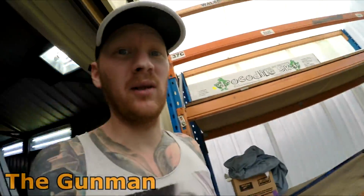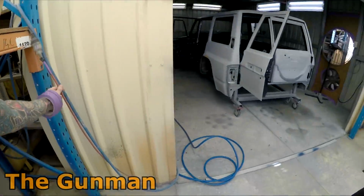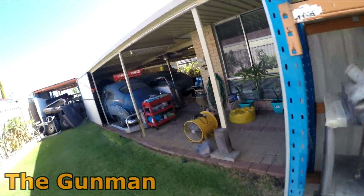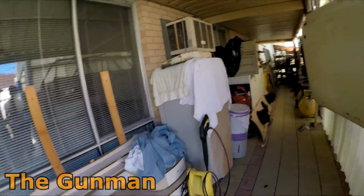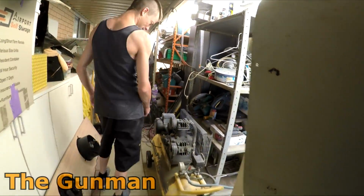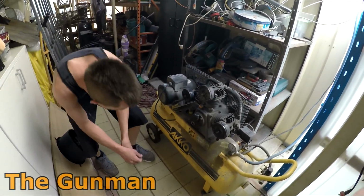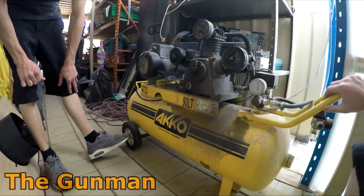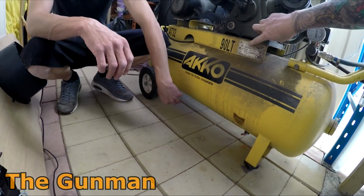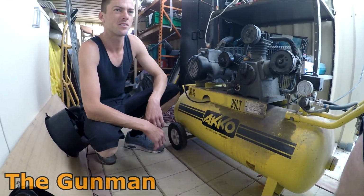We had a little bit of a mishap with the compressor. Well, not the compressor itself, there was an extension lead. Bad safety. But we'll give a look at the compressor, because I'm sure that's going to be one of the questions people ask. Yeah, the biggest one we could buy for 240 volt. Obviously here in Oz it's a bit of a mess, but yeah, man. It's pretty much got 90 litre, and it's going to be 18 CFM. Something like that. It's definitely over the 15. I got told about 15, 16 CFM is the minimum you want to go for, running good pressure and that.